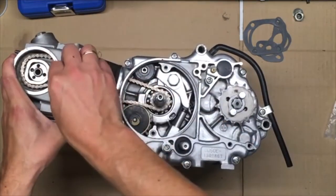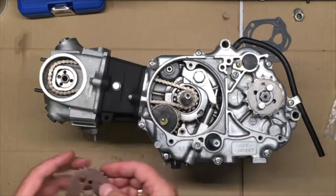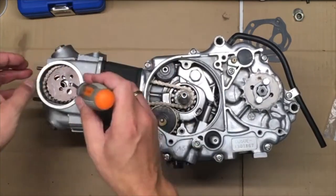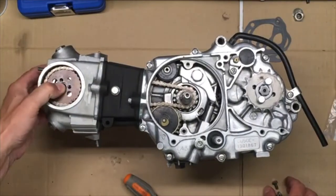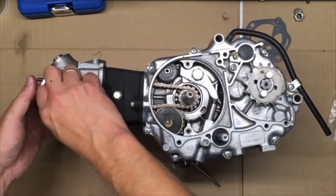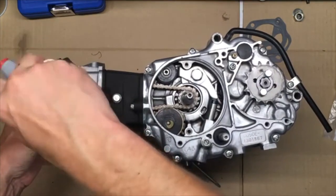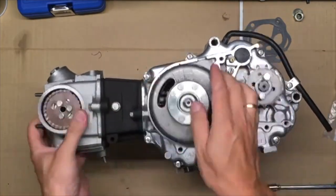The only color available was bright yellow. For the U.S. market, Honda kept producing CT70. By 1980 it bore relatively little resemblance to the earlier model CT70s or the ST70, although parts such as the frame and engine were always the same. To better suit off-road riding, as well as further reduce costs, the fenders were made of plastic beginning with the 1980 model and mounted much higher on the fork. This was also the first year for another new fork design with sweeper style seals and internal springs. Along with the new fork, a new more softly padded seat and better rear shocks were introduced. The 1980-82 models had the nicest ride quality, as well as the longest suspension travel of the CT70s produced up to that time. The ignition lock was moved from the left-hand side of the frame to the triple tree and the speedometer had a redesigned face. The future series of the CT70 type were based on this model and produced by Honda until U.S. model production ceased at the end of 1982.